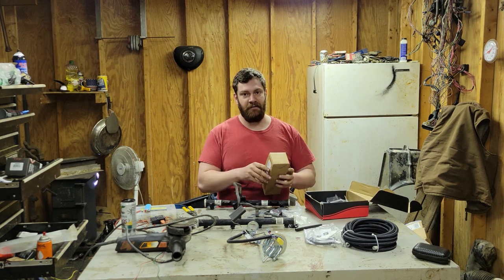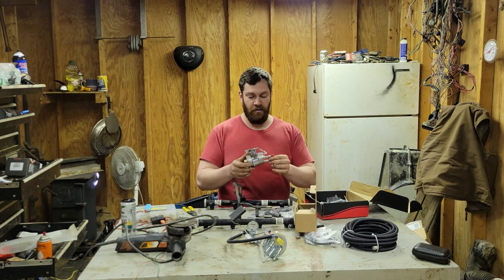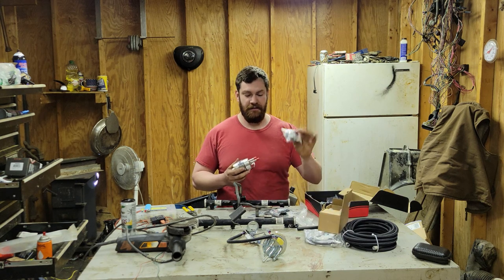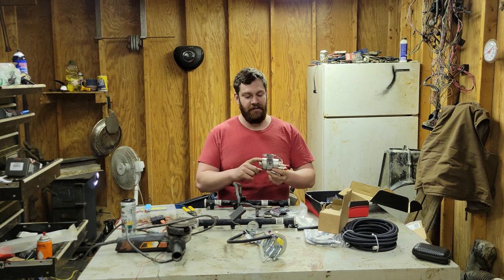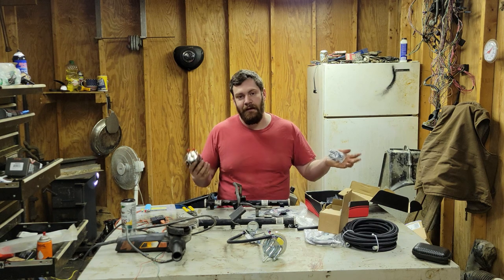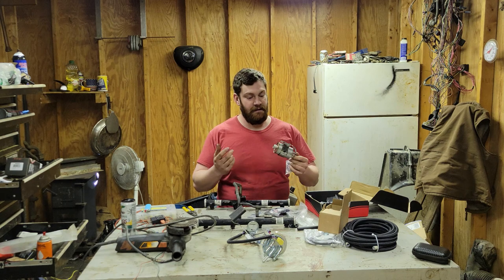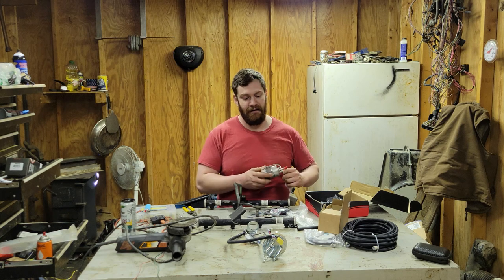Then, because you have to regulate that down to 58 pounds, I got a Corvette fuel filter regulator from Evil Energy, and it comes with fittings. Now, there's been some grouches that say that this is just going to fail unless you get the $100 setup, and you'll end up with a standard regulator anyways. We'll see. I'm going to go ahead and run this for now anyway, and if this shits the bed on me, then I guess they're right, and we'll be going to a standard regulator, but that's not today.